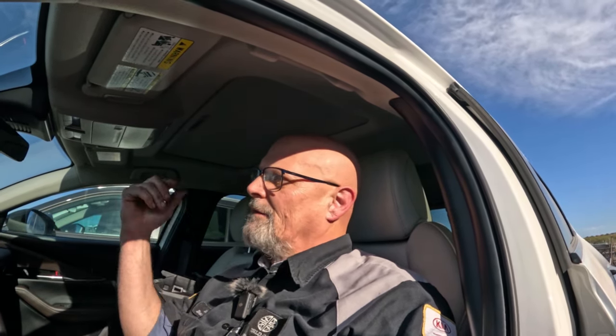Sure enough, the battery was dead. The vehicle sat on the lot long enough that the battery needed to be replaced. It wasn't under warranty — for Mazda, the vehicle has to go three months and 3,000 miles after purchase before the battery is covered. So the sales department paid for the battery. But the worst part: once I got the new battery in, I still had codes that wouldn't clear — smart city brake support, traction control, ABS, forward sensing camera, lane keep assist, lane departure warning, blind spot detection, and the airbag control module had a code.